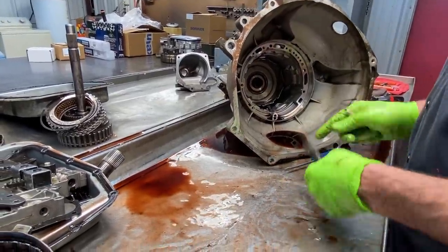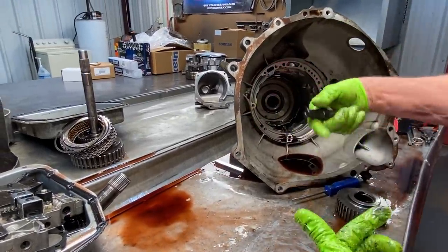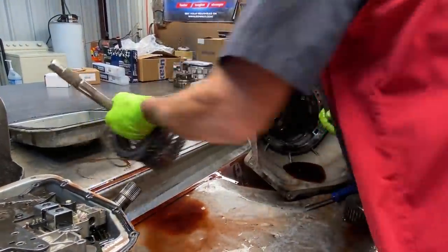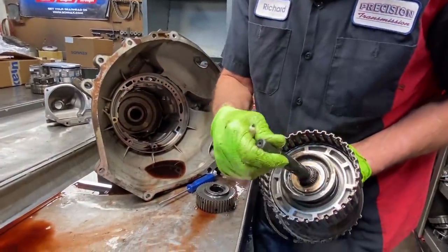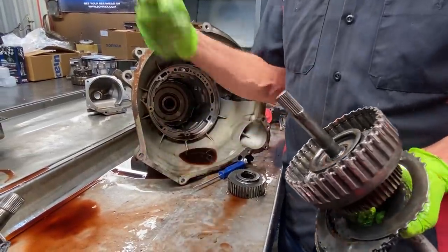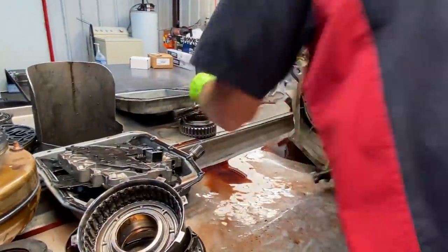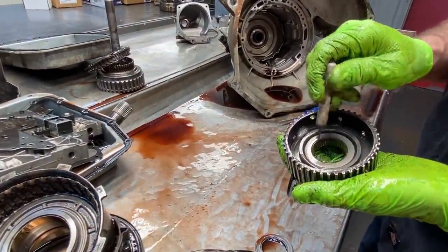On the AODs they had a long shaft that went all the way from the back to the front and locked into the back of the cover on the torque converter, and when it went into third gear it went into direct drive. On this one here they locked third gear right into the back of the input shaft. When it goes into lockup it's going to be controlled by the computer and still have a lockup clutch — that's how they added third gear to keep on going. I'm going to check these splines here for any type of wear.